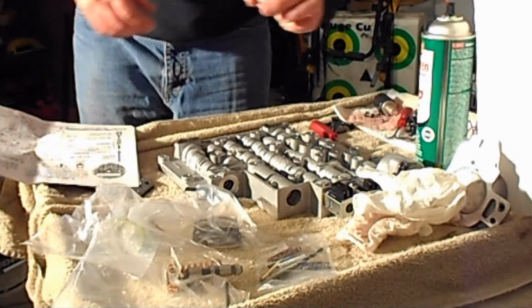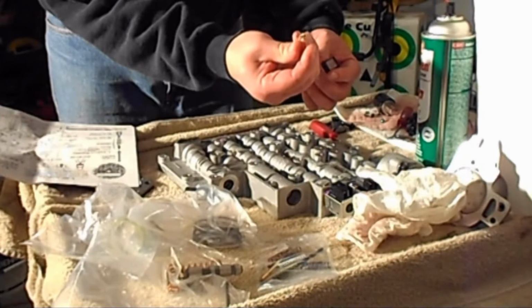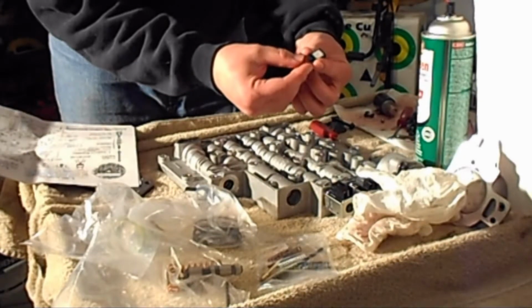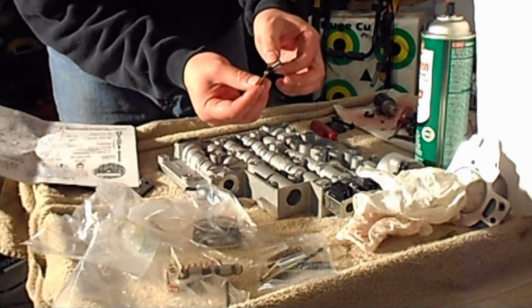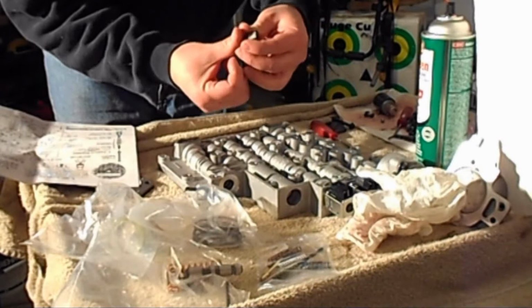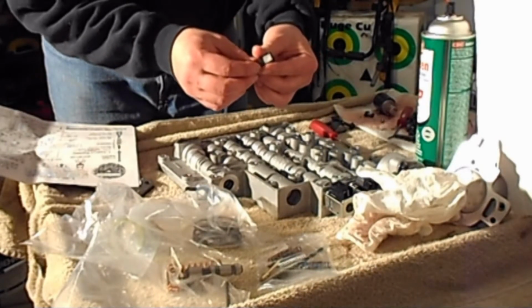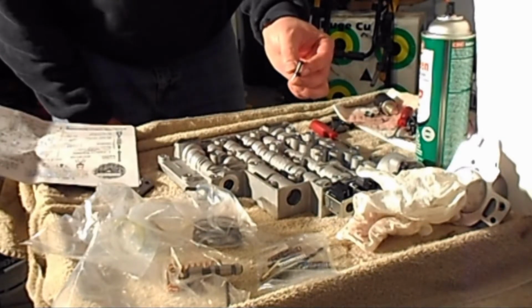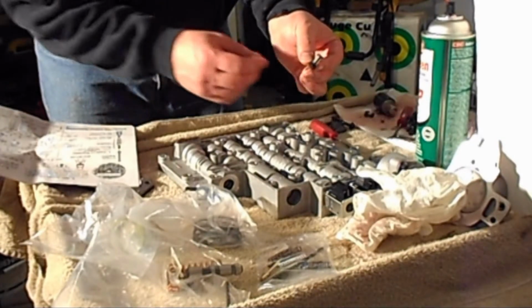So you take your large screen here, comes with this wire spacer, essentially just slides up in there, and that'll keep the screen from collapsing at high RPMs, which causes clutch to burn and along with the band. What happens when the screens touch is it causes low line pressure, high throttle.